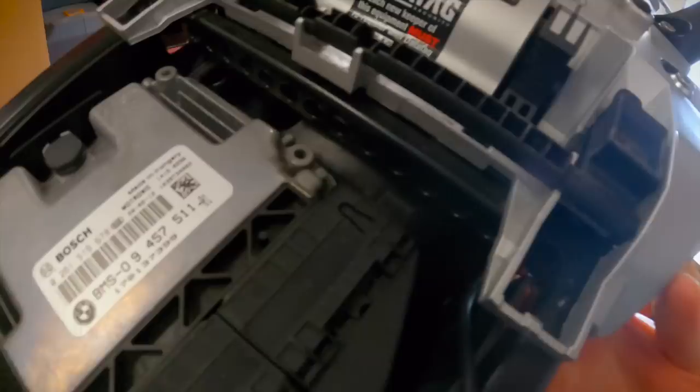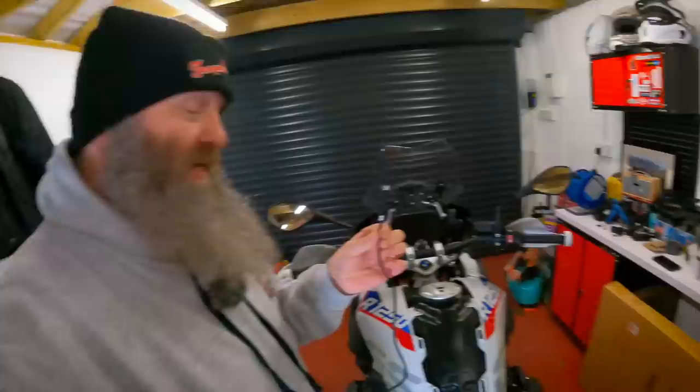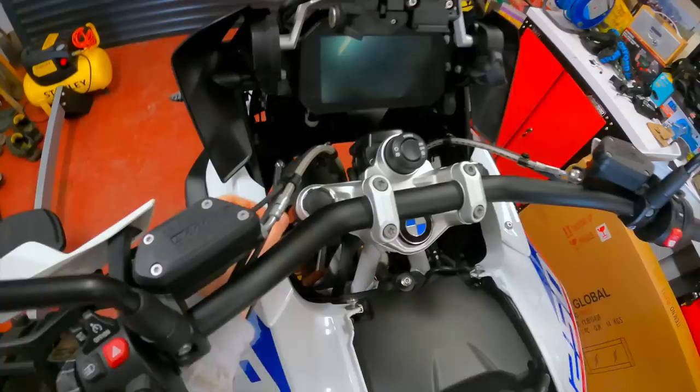I've threaded it up through here and through the little gap in the plastics, so that cable will run through there. The setup is a little bit weird — everything has to connect up to where the DVR module is, which is up at the front camera. So all the cables have to run all the way up the front of the bike and down to connect in there. Wherever you locate that front camera, you've got to bear in mind you need access to run all the cables to it. Both cameras are now located.